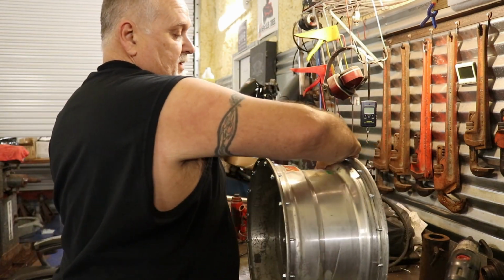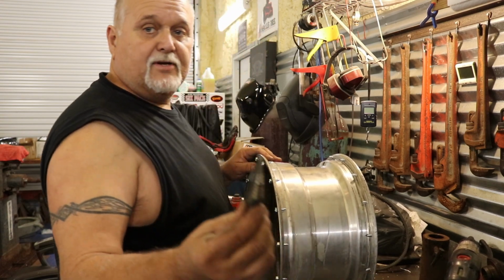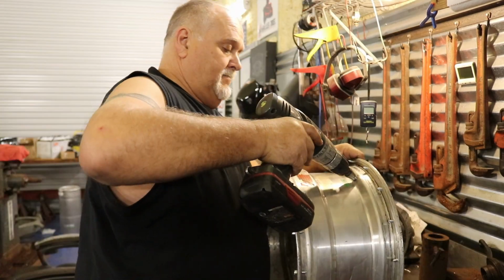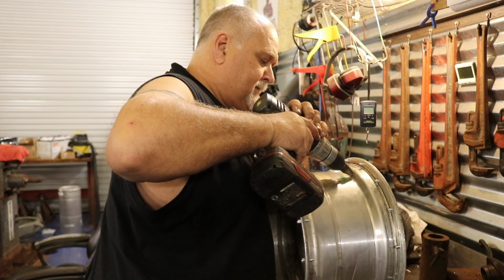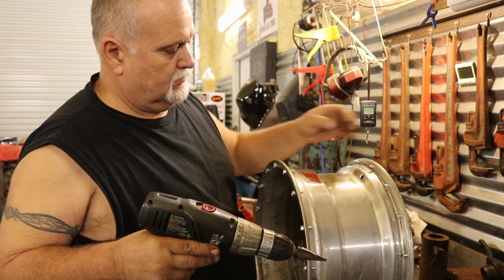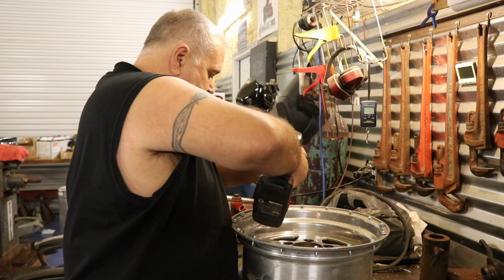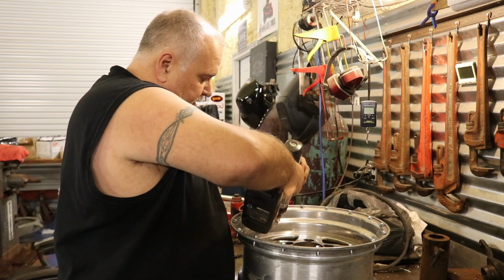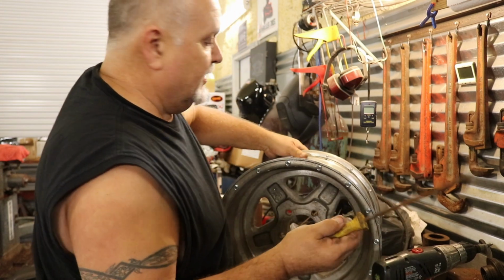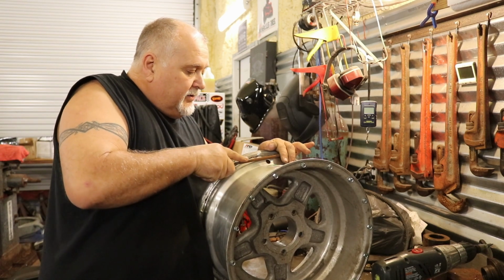I drill from the back side here. And I'm just using one of these multi-drills that go up. I've already done the other one, works fine. Right in. What's good about these drills, the next drill kind of chamfers it for you, so all I'm doing right here, I'm not drilling, I'm just chamfering that sharp edge off. Sharp edges there, I don't want nothing scratching into my tube. Take my file a little bit and make sure there's nothing, I don't want to cut a tube.